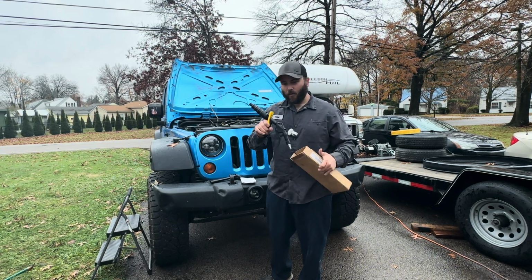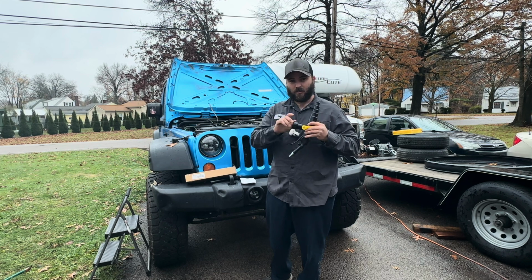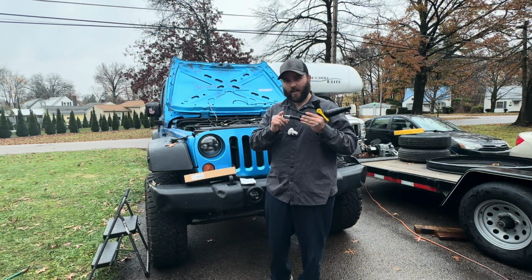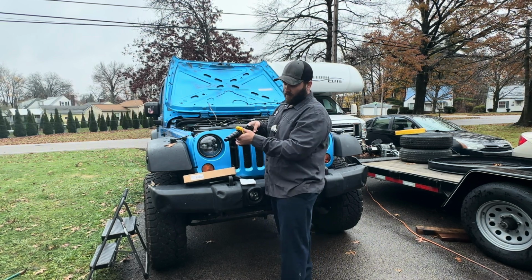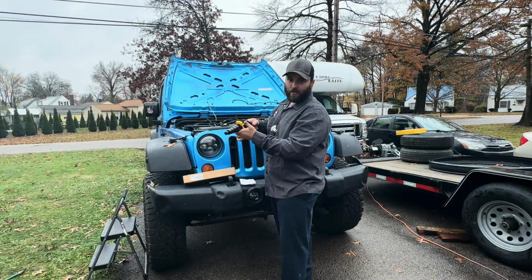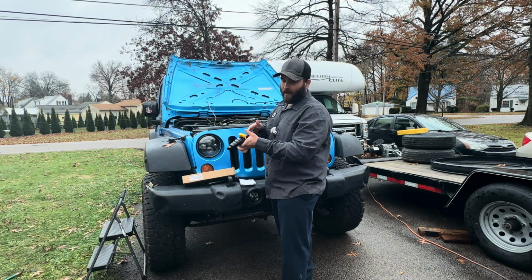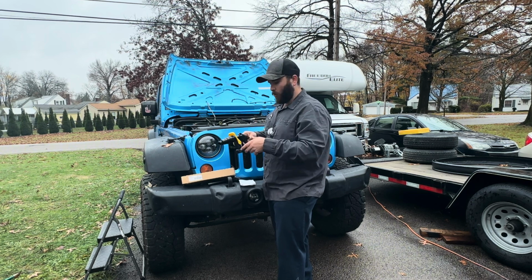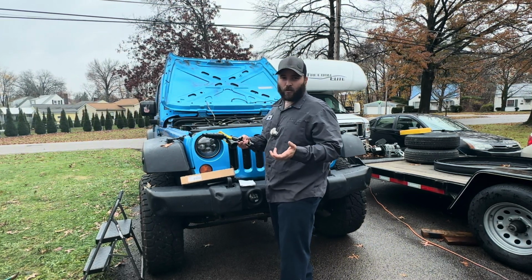just like that. Now what you're going to need to do is you'll hook your garden hose up to this, turn your water on, and then you will need a compressor with an air line hooked to the end of this. So when you start to flush out the system, you just turn the water on, and then you just pump some air into it and give it a break, pump some more into it, give it a break, and eventually that air forces that water through there and flushes out that cooling system. It is a very good tool to use.